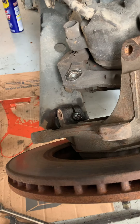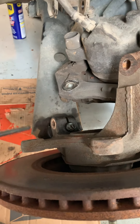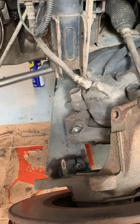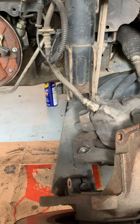As far as removing the axles — the steering knuckle on this side wouldn't come loose from the ball joint. I pried and beat it; I'm not going to spread it too far because these knuckles will break. So I just left it bolted. I removed the bolts from the strut to the steering knuckle, removed the brake caliper and the ABS sensor.